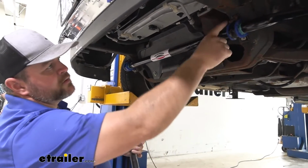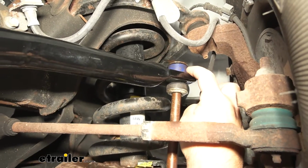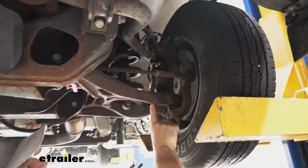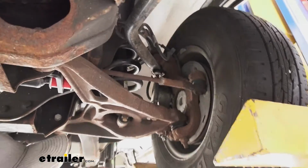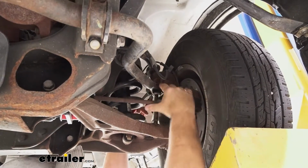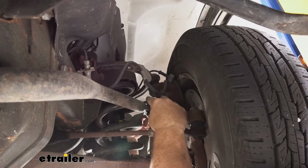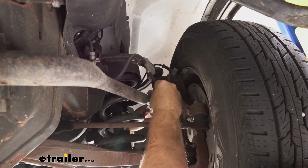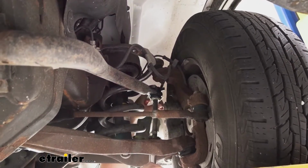Our new kit is actually going to come with new bushings and new brackets here, and a new bushing for your end links. To start our installation, we're going to take a 15mm socket to the bottom. At the very top, the easiest way is to take some channel locks, and it's going to look like a washer there. It's actually going to have flat sides on it. We're going to hold on to that washer with our channel locks, and we're going to start loosening the bolt at the bottom.